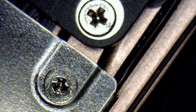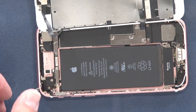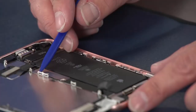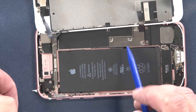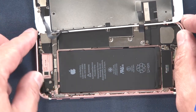As we carefully peel the screen back we see a number of things that are the same and a few that are different. The battery here is a little bit larger and runs up underneath this plate. On previous models they had two separate plates — one for the dock connector and one for the LCD connector, the digitizer, and the home button.